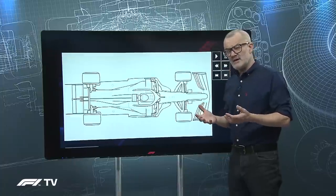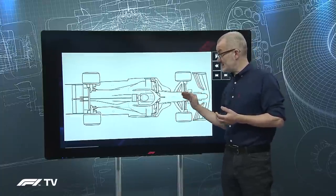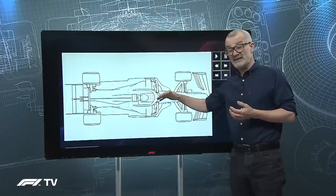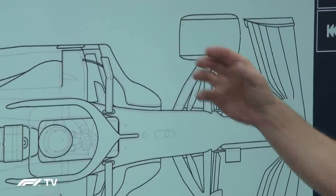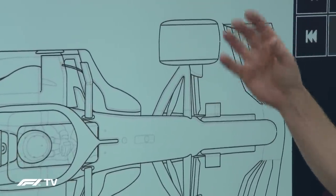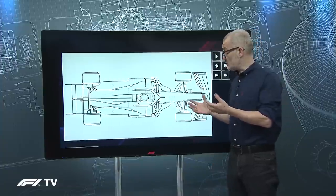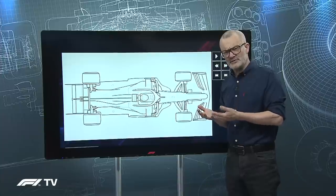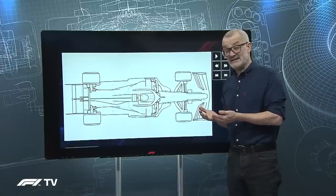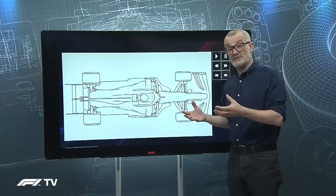Their function at that time was a little bit misunderstood. Most people thought it was to allow airflow along the inside and into the side pod more efficiently — and that is at least partially true — but the primary purpose was still outwash. They were trying to get airflow to go outwards, to push the turbulent front tyre wake away from the car. But as with any piece of bodywork on a Formula One car, a primary function isn't enough. You want to look at other areas where you can improve performance — ideally either reduce drag or increase downforce — and that's where we've got to nowadays.